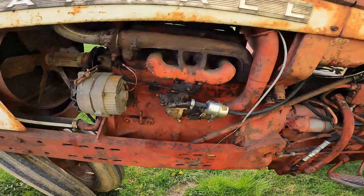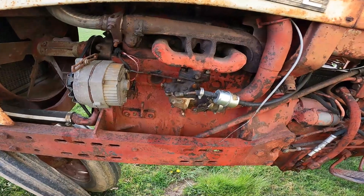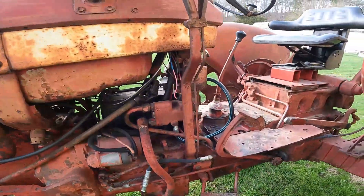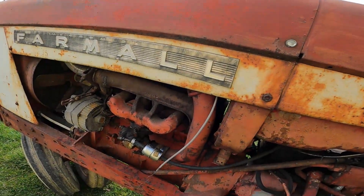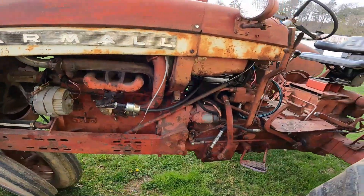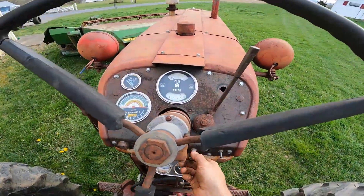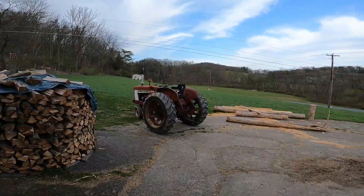Cleaned everything out — I think the float was stuck because it was hung up. We'll see if it runs out of there. I'm pretty sure it would have been running out by now, so I'll fill it up with gas and hope we don't have to do that again — though we probably do because I think there's junk in the tank. Topped her off with fuel, it's still not running out, so I think we're good. So far so good, I don't know how long it'll last.